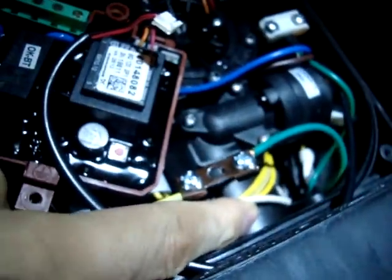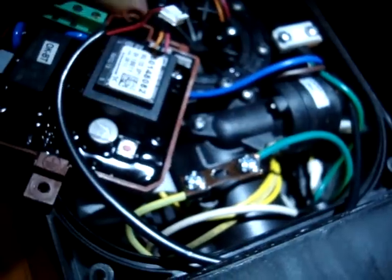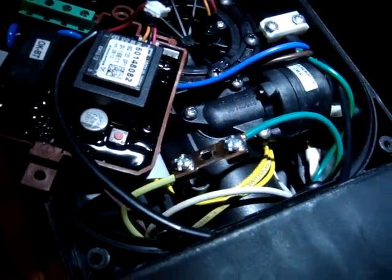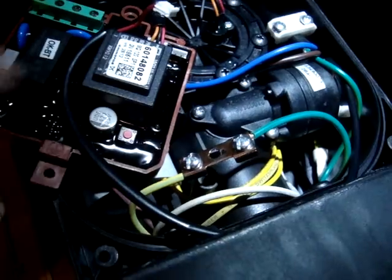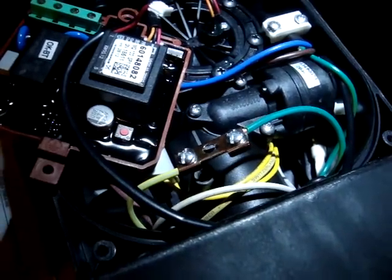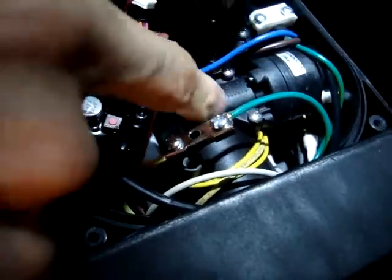This right in here is a non-return valve in this area, so it basically keeps these two components under the pressure that you see on the gauge. This is on the pressure side of the pump because of a non-return valve right here, and that's the reason you want to discharge it and get it out of the system — otherwise when you loosen this you'll get a shower.